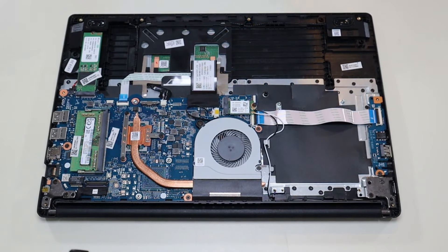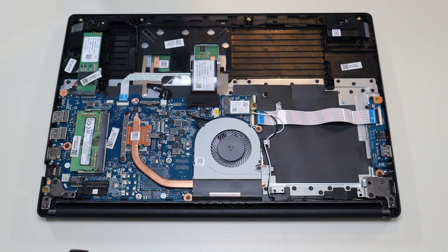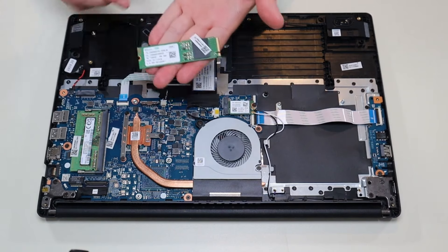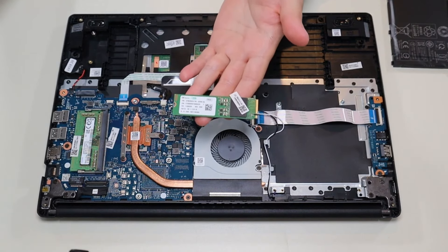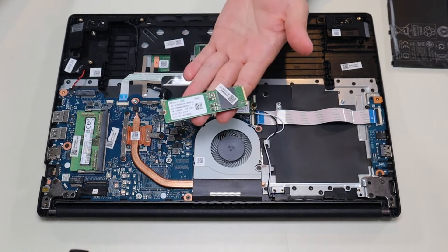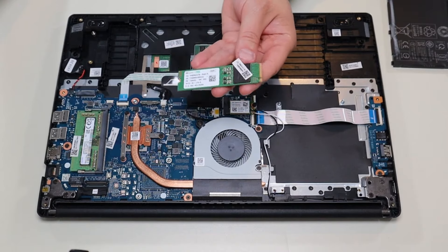Now that the battery has been unplugged, it's safe to proceed deeper into the computer. Your solid-state drive is right here — it's an M.2 port. A single screw holds it down, so I can undo that screw and the solid-state drive releases. This SSD is M.2 NVMe and supports Gen 4 solid-state drives. The one that came stock is 256GB, so it's kind of small. I'll have 500GB and 1TB upgrade options in the link below. Keep in mind a new SSD won't have an operating system, so you'll need to install one.